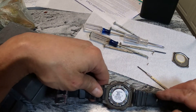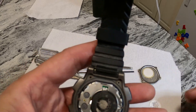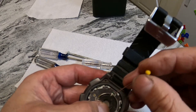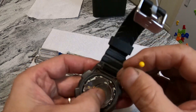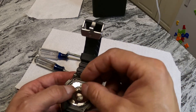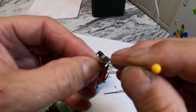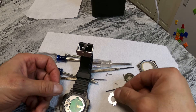Now it says a different type of battery — it says the B85 or M454. When you get to this point, you need a pin — like a sewing needle — because there's a little hole right here that you stick the pin into. When you stick the pin into this hole you grab the other part of this little latch. There it is — it's off. You put the pin in between the clasp and pull it off, but remember how this goes on.